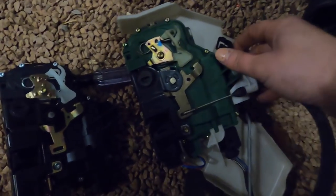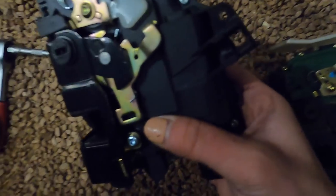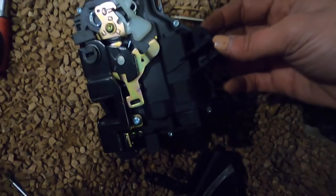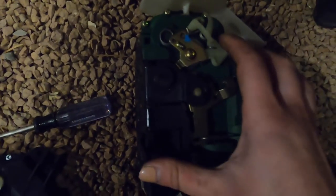Yes, there she is — wow, we've done it. Looking at the old one and the new one, they are identical, except for this small little wire bracket. Mine does not have that, but I honestly can't remember what it's for, so hopefully it's not a problem. We just have to swap over the cable right here — it's going to hook in here, and then the cable bracket goes right into this clip, and the plug. That should be everything. So when you pull the door handle, it makes this piece right here push and unlock the door and open it.